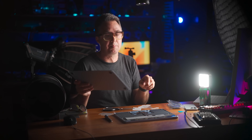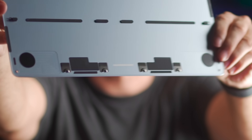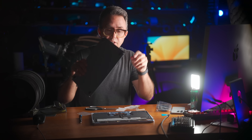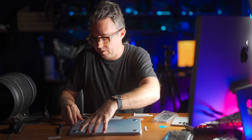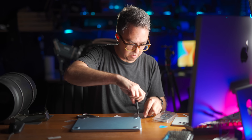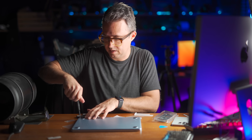That's it — you just slap those on and put the case back on. When you put the case back on, this is important: see these four little grabby arms — those four little things have to grab onto these four standoffs. So basically when you put this back on, make sure you align those up and then put pressure down while sliding it forward. It's weird and you might not get it on the first try. Once you get that on, look down the edge — you'll see bowing if you missed, then you have to try again. Don't forget about those pushy snappy clips — they will find their spots, but you have to push kind of hard and you'll hear the clicks. Fully threaded screws are towards the front, towards the trackpad. Do not over-tighten — if you strip these, you have to admit that you opened it.